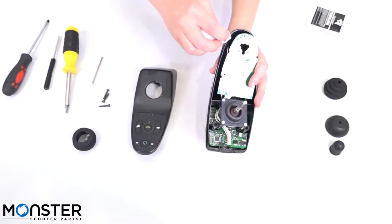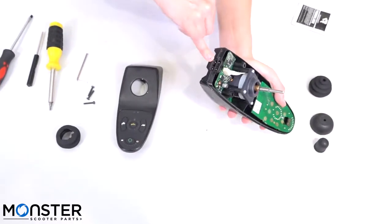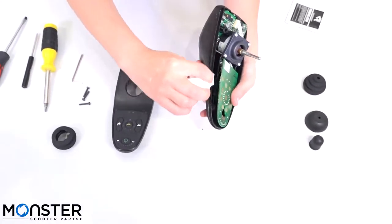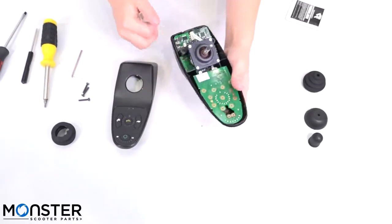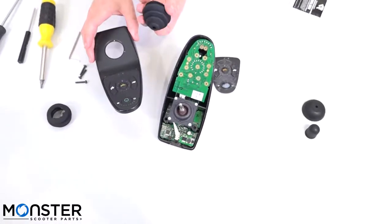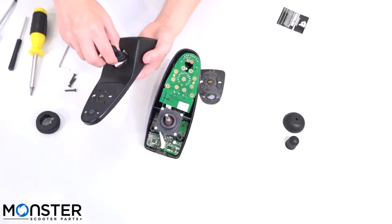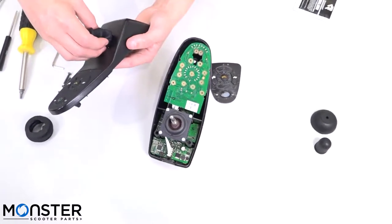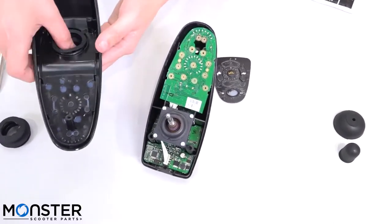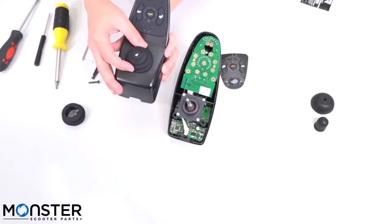While you're at it, you can also clean off the edges of the bottom part of the joystick controller. You'll also want to double check your contacts here to make sure that they're good and not bent or anything. Now that that's all clean, we can go ahead and continue with placing a new boot onto the top. To do so, get a replacement boot and gently squeeze it towards where the bottom flap is going into the hole. Flip it over and make sure that it is all flat — and if so, that is great. We have now replaced the boot.